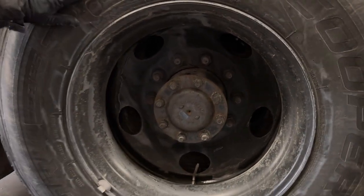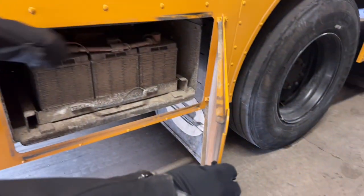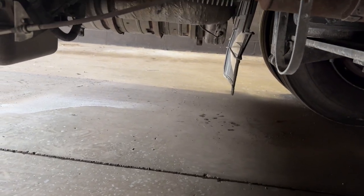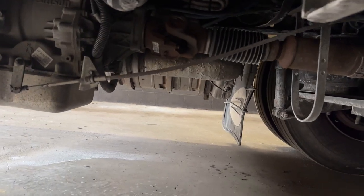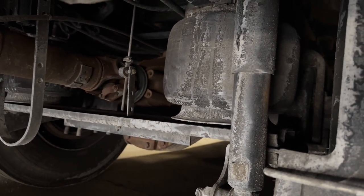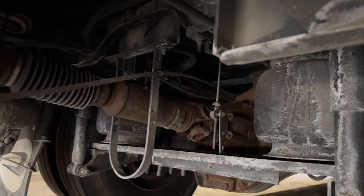The rim has no welds other than factory, no abrasions, bulges, or cuts on the inside or outside of the tire. Here's our mud flap — bolted and mounted securely, not cracked or broken, loose or missing. Our battery box: all batteries are in place, connections are made, and we check for excessive corrosion. We're going to take a look at our drive shaft — it's bolted and mounted securely, not cracked or broken, loose or missing. We're also going to take a look at our shock absorber — it's bolted top and bottom, not cracked or broken, loose or missing. We're also going to take a look at our airbags — they're bolted with top and bottom air mounts, not cracked or broken, loose or missing, bolted top and bottom. Our torsion bar is not easy to see but it's not cracked or broken, loose or missing, and appears to be functioning normally.